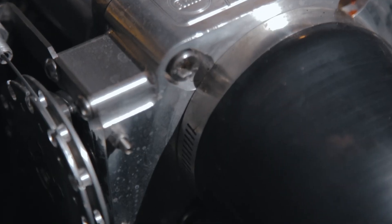After letting all the RTV dry and checking everything out, the next day I started the car. I made sure that it fired up, and then on the side of the throttle body there is an Allen screw that adjusts the throttle plate — it opens or closes it depending on if you need a higher or lower idle. You just kind of play around with it and find its sweet spot. After getting the car to idle correctly, I went and test drove it around the block to make sure everything felt okay.